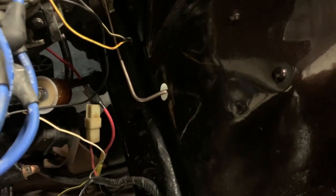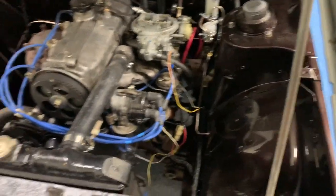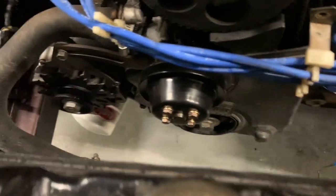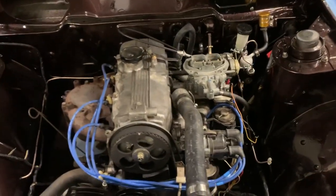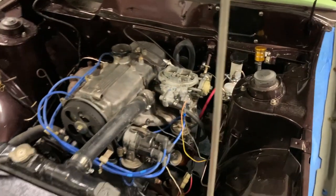But I got the brakes bled, everything's routed, just need to get the little grommet for that side and that side. But other than that, she has brakes, so she stops. Only thing I got left is I'm waiting for the guy to send me the crank pulley, and I need to get a fan so I can wire up my fan, relay, and then register, and then she'll be good to go. I'll be able to daily drive her, work out any little kinks that come up.